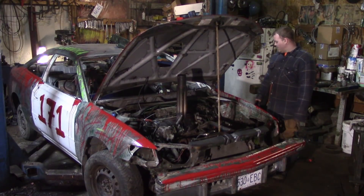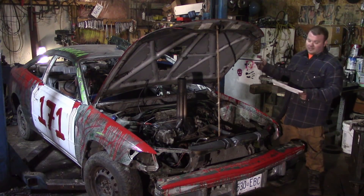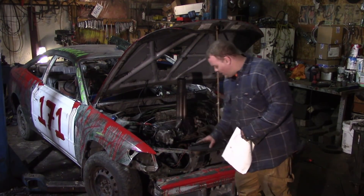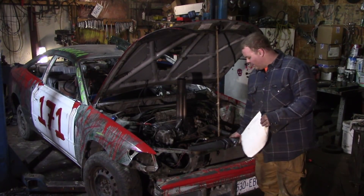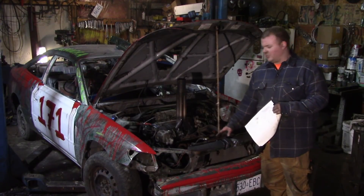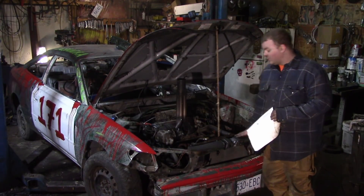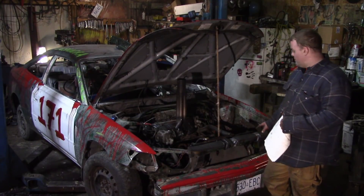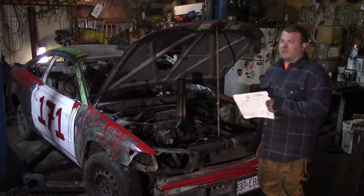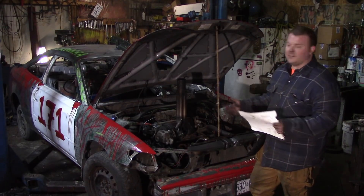We've been working on this thing pretty hard tonight, really crunching these numbers. We got the door in. We haven't done the spare tire but I need to sit on the ground for that. We have the alternator power hooked up. We also put really nice thick padding around the alternator and in front of the rad. I got a little upset with the duct tape so I'm going to get more to try to soften the hood around the rad — I think the hood is actually the culprit breaking my rads. Fans are not hooked up yet but we have the toggle switch, wires, and power all ready — it'll be quick, just easier to do on the ground.